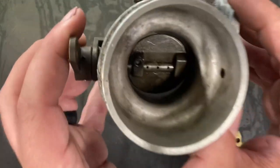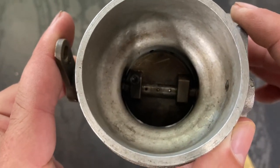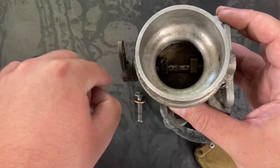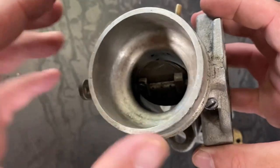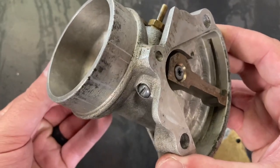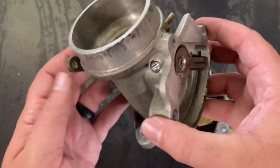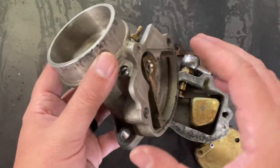That shallowest point allows only so much fuel to get past and head up the arm. The throttle shaft is actually hollow — it feeds fuel through the shaft and through these small orifices on your throttle plate, right through it. That is what allows air through, creating your venturi effect. As the throttle plate opens and the demand for air increases, the arm supplying fuel positions itself in a deeper section of that groove, allowing more fuel up and in to atomize with the air.